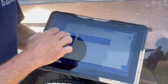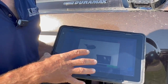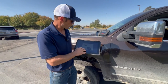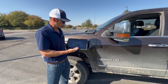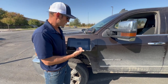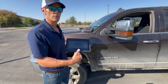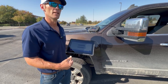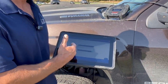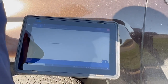What I want to do is go ahead and do a total system scan. I want this TEXA tool to go ahead and scan all of the modules and ECMs equipped in this truck. Here it'll show you what connector to use — your standard OBD-2 — and a video showing you where to connect. It tells you what to do and prompts you for push button activation starts so that you can carry out diagnostics the right way the first time.